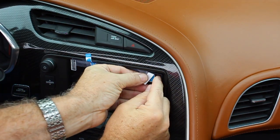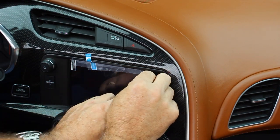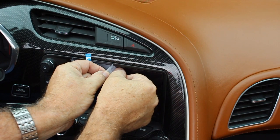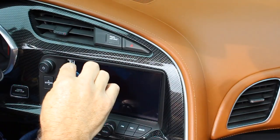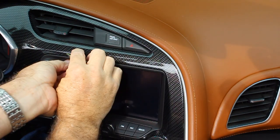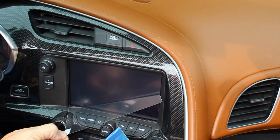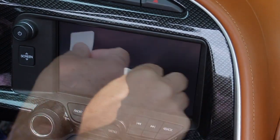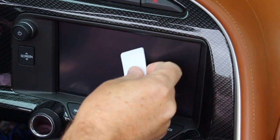Now remove the scotch tape, then pull on the front tab that's still attached to the screen protector and pull back — this will remove the top clear coating. Go ahead and use the cardboard squeegee provided in the kit to remove any remaining bubbles. Once any remaining bubbles are removed, everything is done except for an ops check.